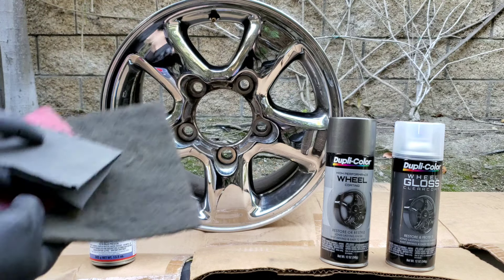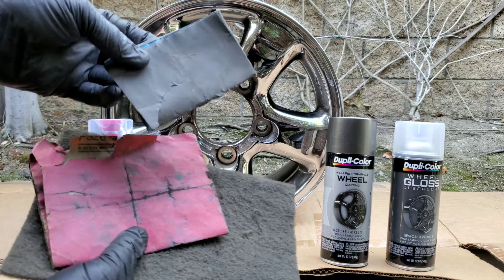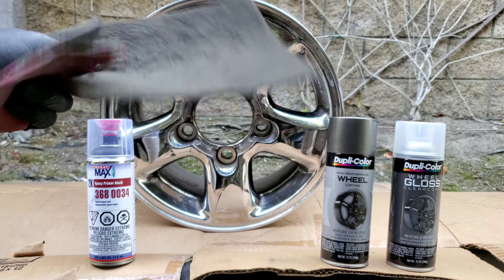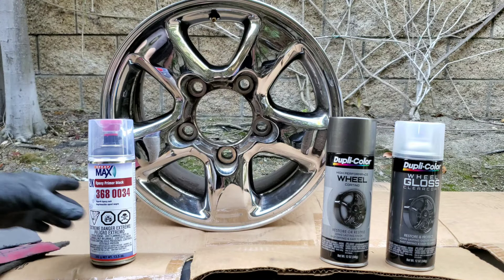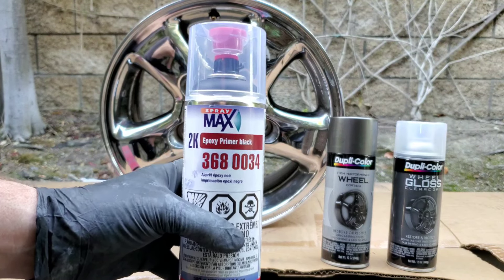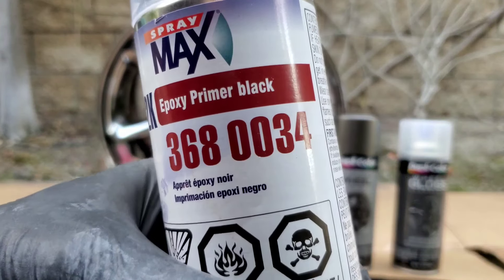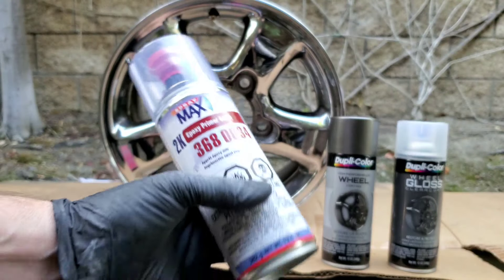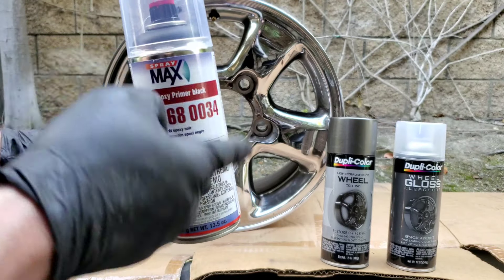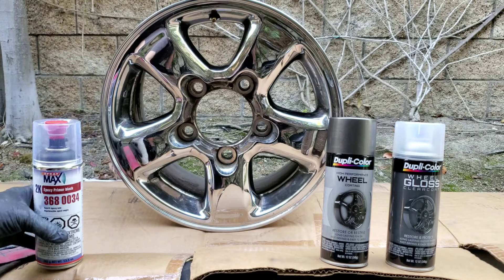Simply put, we're going to rough up the surface. I've got 320-grit sandpaper in two different styles and a Scotch-Brite to rough it up after that. Then you must prime — you have to prime chrome wheels. Not just any primer: you need an epoxy primer. This one you have to mix — take the cap off, put it on the other end, and mix two products together. Once mixed, you've got 48 hours to use it.